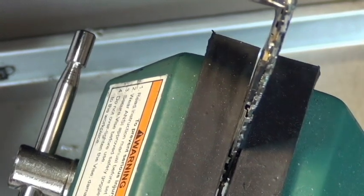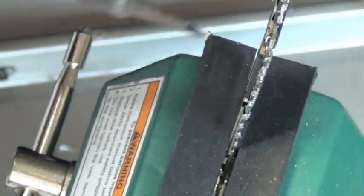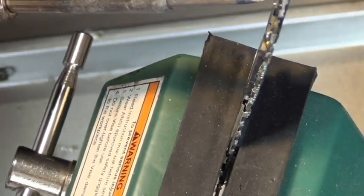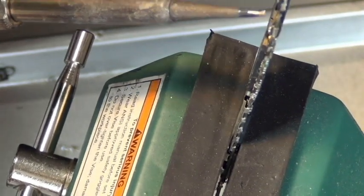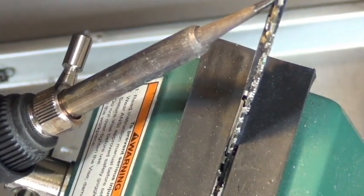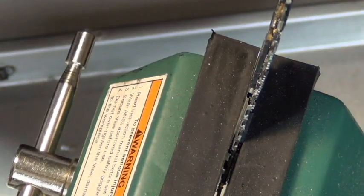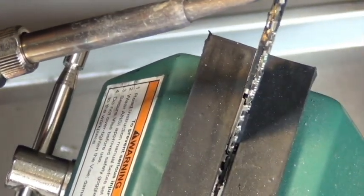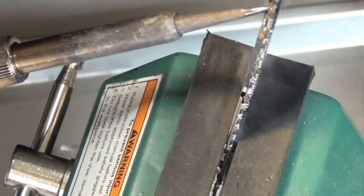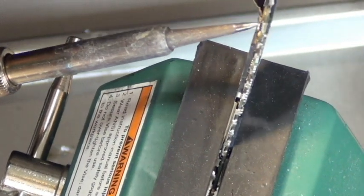So yeah, I am not offering this repair on my website, mostly due to the shield. It takes way too much of my time, way too long to do this. I don't think I can do this on a regular basis. But I do sell the parts, like if you want to get the iPhone 5 backlight IC and backlight coil and the three backlight filters. Strangely, iPhone 5 has three backlight filters. Previously in iPhone 4, iPhone 4S, and even the 3GS, Apple had two backlight filters, one going into the screen, the other one coming out of the screen for the current. But iPhone 5, I guess it's due to the retina, this bigger screen or whatever reason, has three backlight filters.